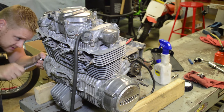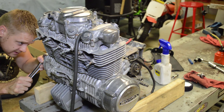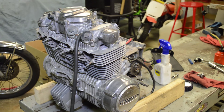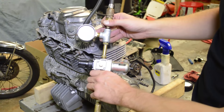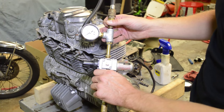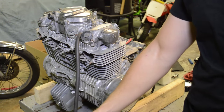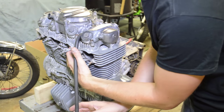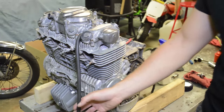I'm coming up to TDC here. What's nice about this low pressure is it does not roll the motor over. I'm at top dead center and you can hear a nice leak. If you look at the pressure gauge, it's at 12 — we were at 22, now we're at 12. Let's see where the air is coming from. I put my finger in the exhaust and you can just hear it — so we have an exhaust valve leak.